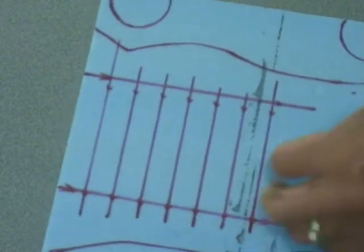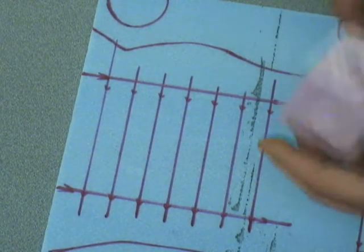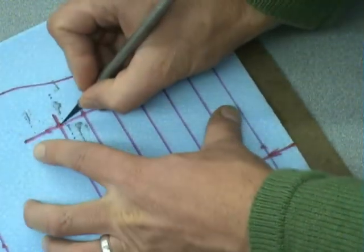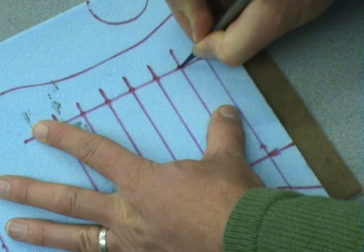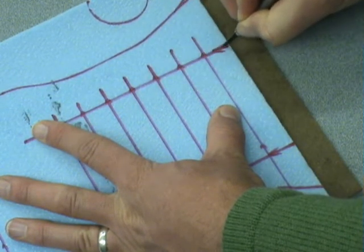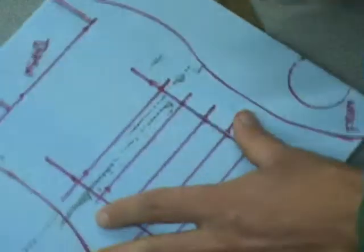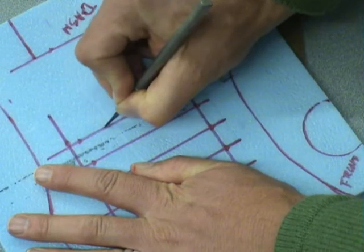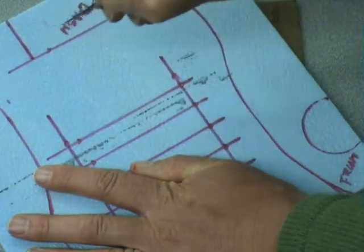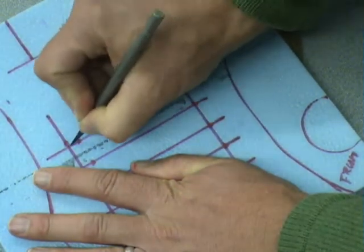out all of these, and the way I would do this is just the same thing, up and down. And then pull that across, score it out, and you can see that that cuts very nicely. Then I would cut this one out, and you notice that I'm always cutting away from my hand, and I just go up and down, and I'm holding this X-Acto knife like I showed you before, like a pencil. I just go up and down, and then I pull it across.